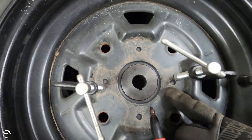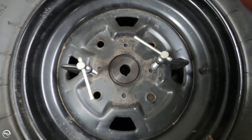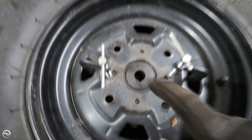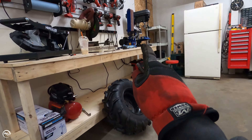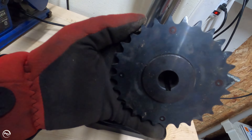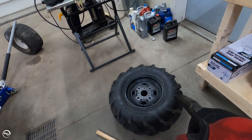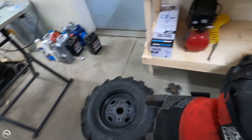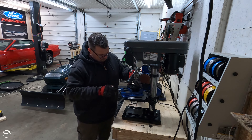Here's the method to my madness. Got a couple little C-clamps going into the back side of the wheel, holding that on. All I did was eyeball this as center as I could. It probably could get a little bit better, but I'm just going to mark these now and adjust it a little bit more. I realigned it, marked them out with a sharpie, and then I took a prick punch to the center. So we're ready to take this bad boy out and throw her on the Harbor Freight drill press. Here's what she looks like now outside of the wheel — I'll start with 1/8 inch, and then I've got to check and see what size holes these are. Looks like a 1/4-20 will fit. I'll check a 5/16ths too, and then whatever that is, I'll make the same dimensions on this guy here.